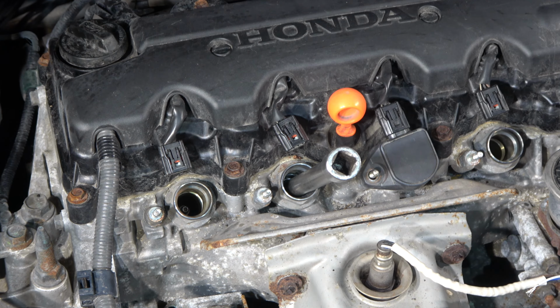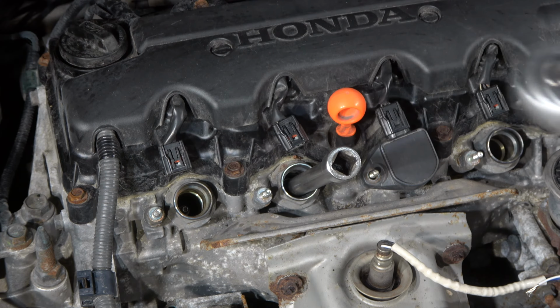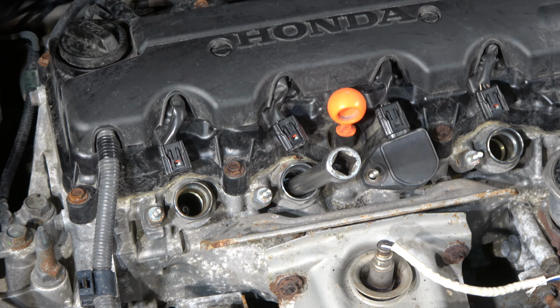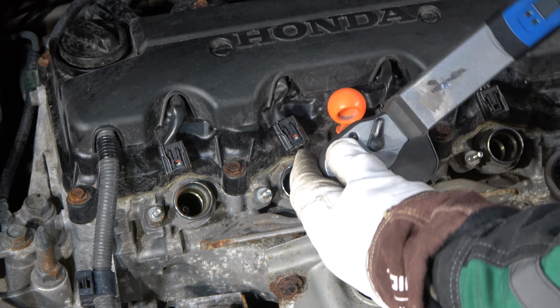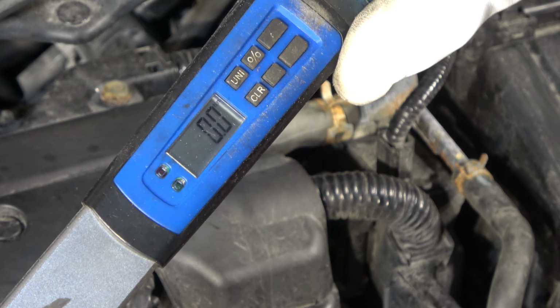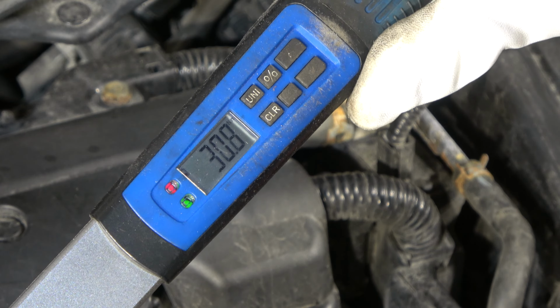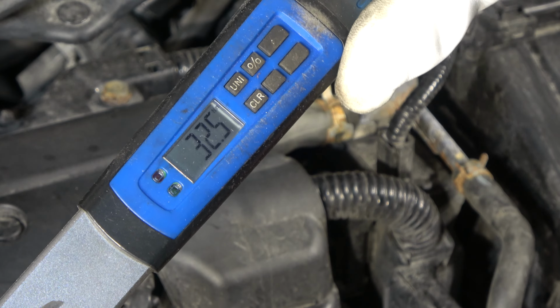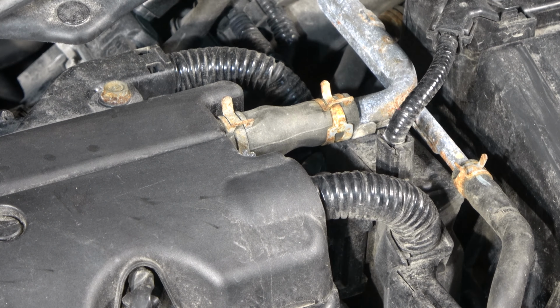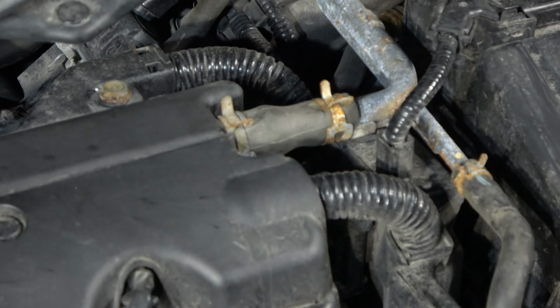When we can loan or purchase this torque wrench tool, I have here this digital one, and now when I move my tool, it makes a sound when the force is okay. You can see in this tool that there is a digital amount in newton meters, and when there is this sound, now I have a little bit more force in there. It is about 30, and that's why I have to release this spark plug a little bit, and I repeat that, and let's check again.